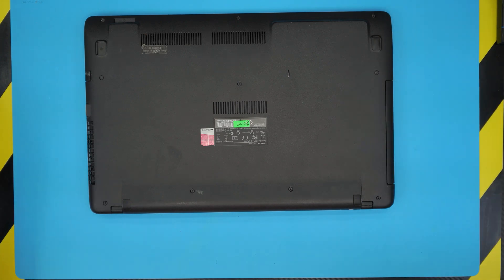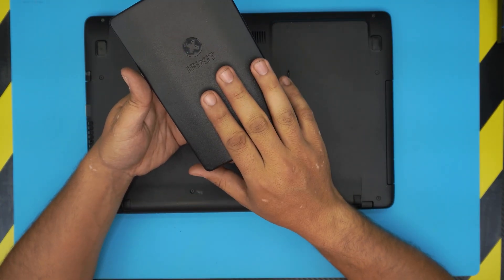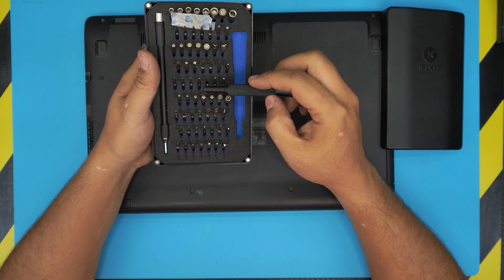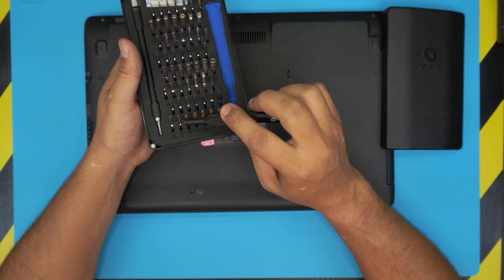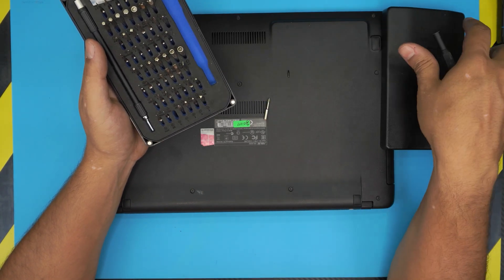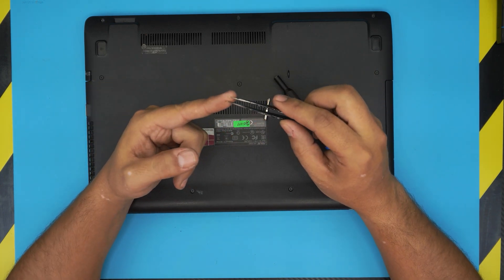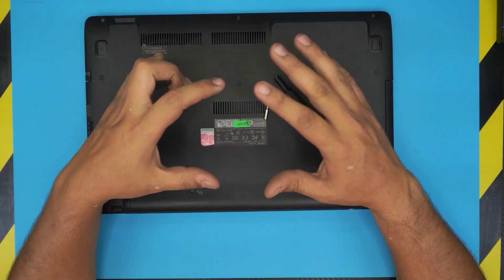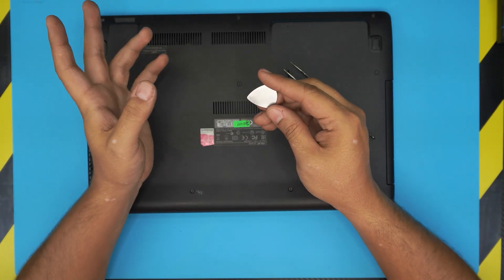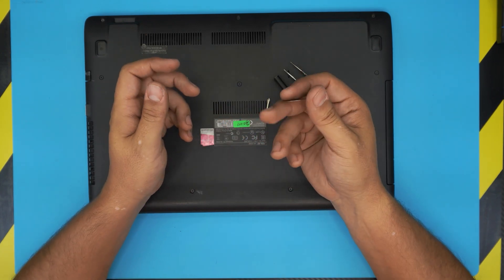It is actually upgradable and not too hard to get to. For tools, I really recommend the iFixit toolset — one of the best on the market, with all the bits you need for phones or any electronics, and they're hardened to last much longer than off-market sets. You'll need Phillips number zero, sharp tweezers, and an opening tool. If you're on a budget, a metallic guitar pick works very well.